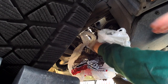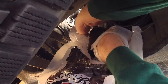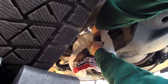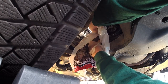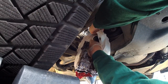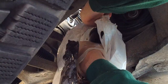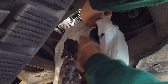Here's where my bag trick comes in — this is the trick I wanted to show you. I take a shopping bag and get it up in there, wrap it around, and take my time to make sure it's lined up properly. You want the ends or necks of the bag really behind the oil filter manifold where it's holding it, aligned so it's above the filter and hugs it. The bag is going to catch the oil that comes out of the filter — otherwise the oil goes all over the place, spills on the frame, the chassis, the floor. I spin the filter off and all that oil falls right into the bag.